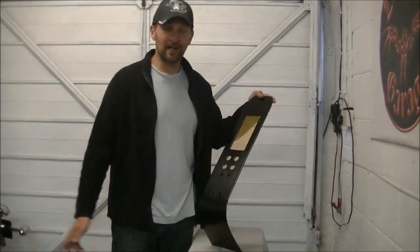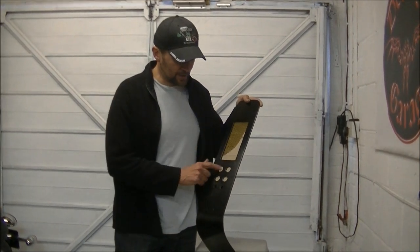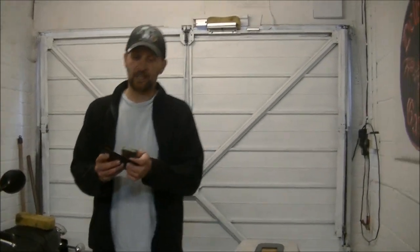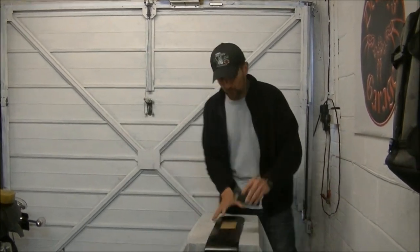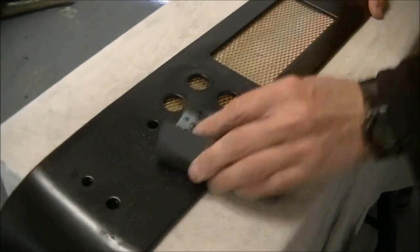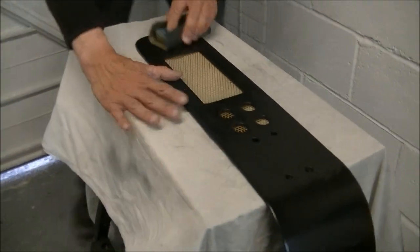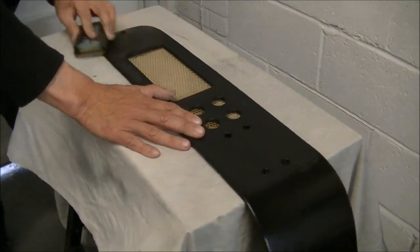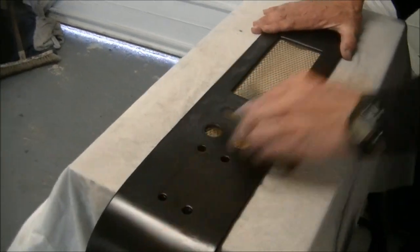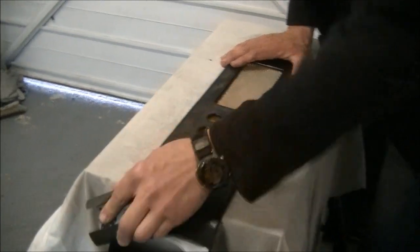There's no point worrying about making this into a nice finish. All the time taken to get that lovely and flat — it's now got this wrinkle finish. If it was uniform I'd have just whacked it on there, but as it is what I'm going to do is key it up with a little bit of 320 grit and then put the frost wrap straight over the top. I'm going to mask out this mesh so we don't get any on that, and that will be it. Six coats tonight. I'm going to do it dry as well because I don't want to get water in all the little joints — this is just a scuff up. Just with a flat board, I'm going to scuff that up and take the tops off everything.